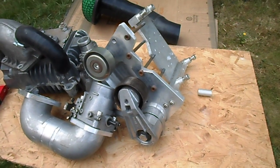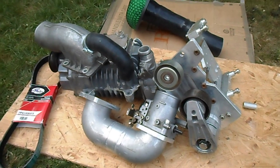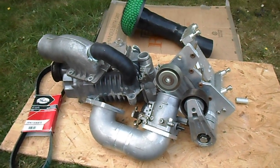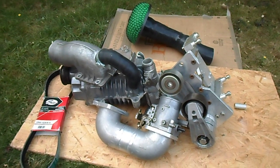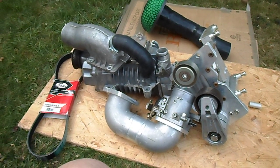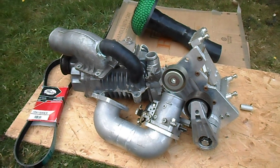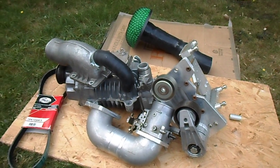It came together quite well, to be honest. It was a good thing I had the original aircon pulley and pump bracket because it gave me a lot of ideas on how to do it. I've seen a lot of people mount these on the exhaust side but I didn't want to do that because then you've got to start moving pumps and alternators, and I want to keep it as simple as possible - and it looks quite tidy as well. It's a bit of a labour of love and taken a bloody long time, but it's all bolted up. I've also removed the battery so I think the corner weight is pretty much the same. Next video will be installing it on the car - thanks for watching.